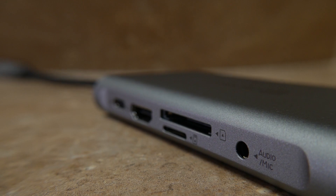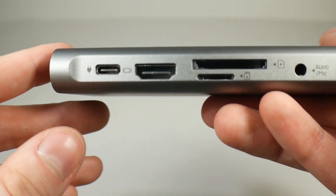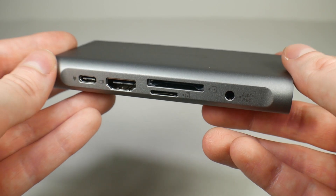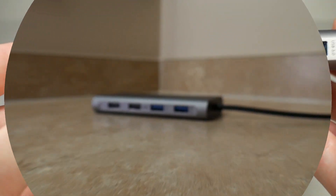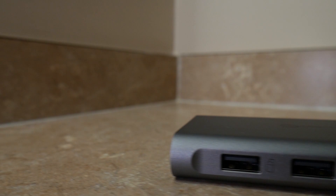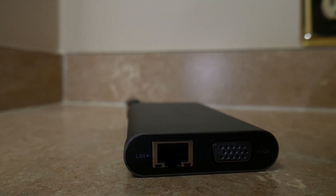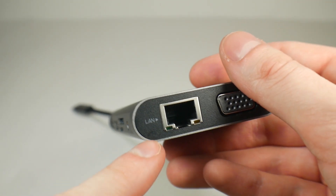For example, to the new MacBooks on sale right now. Here we have the HDMI port, which supports 4K 30 — so not 4K 60, unfortunately, but 4K 30 FPS. We also have your standard SD card, your standard micro SD card, and your standard 3.5 millimeter headphone jack for all those people who have newer MacBooks that don't have those. On the other side, we have two USB 2.0s and two USB 3.0s. They specify mouse and keyboard for the USB 2.0 ports — I don't know if there's a reason for that or just a recommendation. You can tell because of the color difference. And then of course we have your VGA port and your ethernet port, useful if you have a newer laptop without those or if you really just like having super fast speeds.